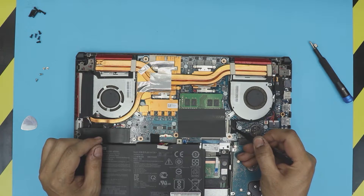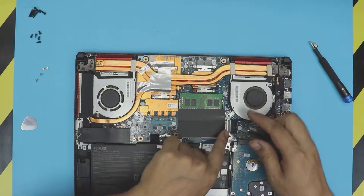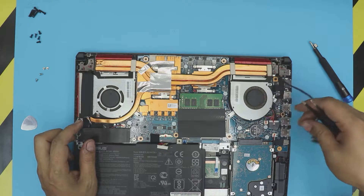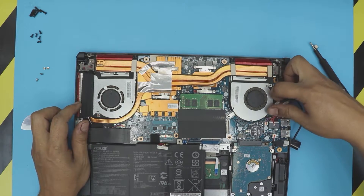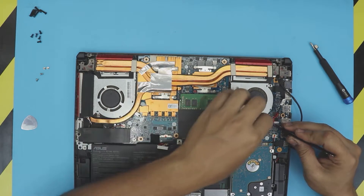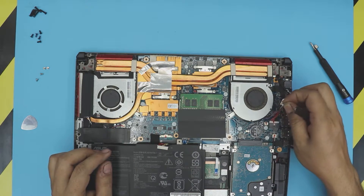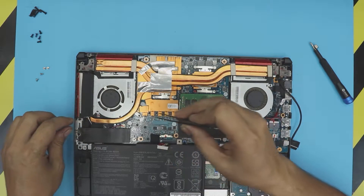There's a tiny flap — lift it 90 degrees and slide out the flex cable. The power jack cable is right here, loosen that up. The fan cable is right here — just unhook the jack and slide it out. The fan jack is out.